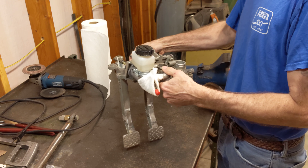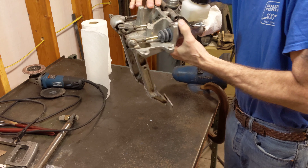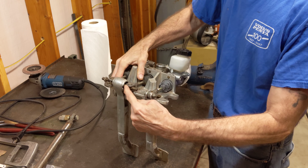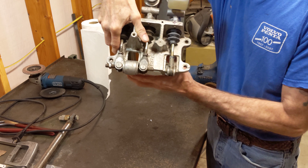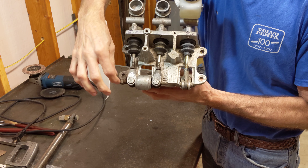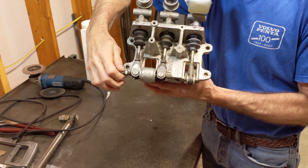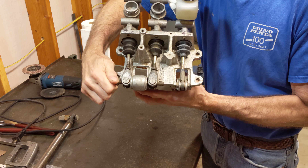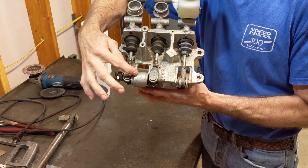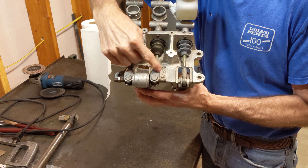The way it works — the brake pedal comes up and has a hollow cylinder, and inside that hollow cylinder is a spherical bearing that can float back and forth. That bearing is tied onto a shaft that is threaded, basically one way, so if I start screwing this it pushes the spherical bearing one way or the other in this tube, in relationship to these two clevises here, which push on the master cylinders.